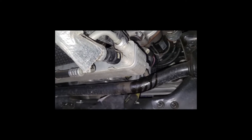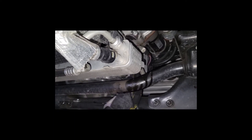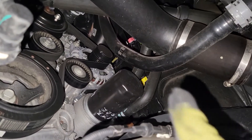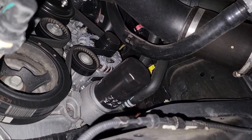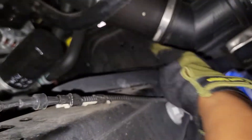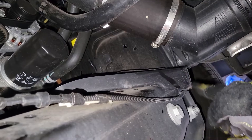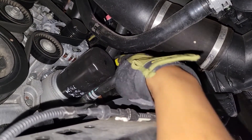After tightening the bolt, I'll go back and wipe down wherever oil has spilled for a general cleanup, then move on to the oil filter replacement. The oil filter is easy to locate — go from the front of your car near the passenger side, go underneath, and look to the right. You'll see the black oil filter. Ford has supplied a channel that directs all the oil to the driver's side so you can put your catch can there.